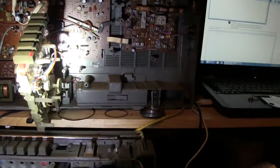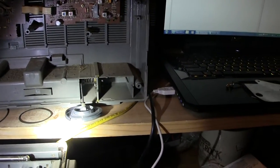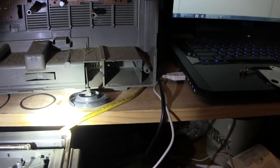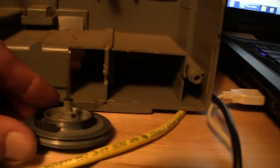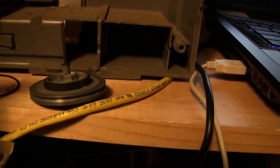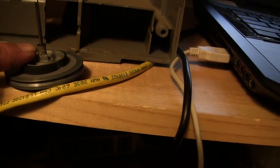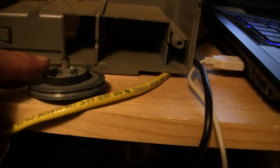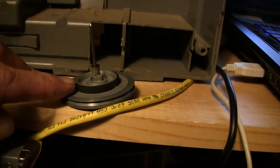This here is a tire that came off of the flywheel — see how it's broken. Let's try it without the light. This tire goes around the flywheel right here, and that's what came off of this one. This part here — that's the drive wheel — and this is a tire, but this one here went to goo on this deck.